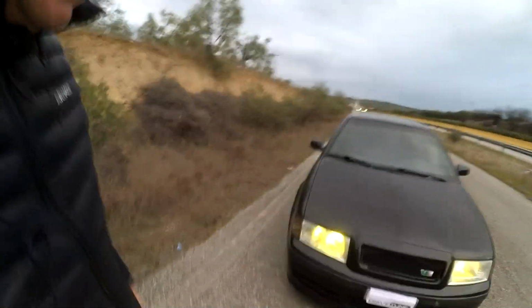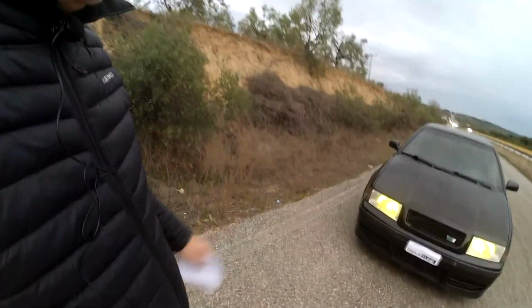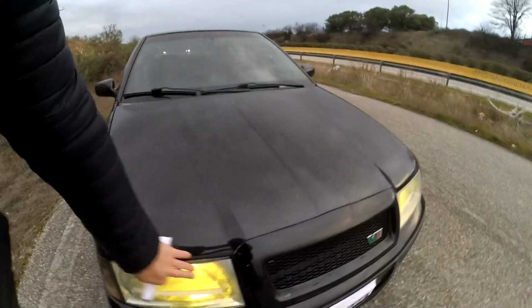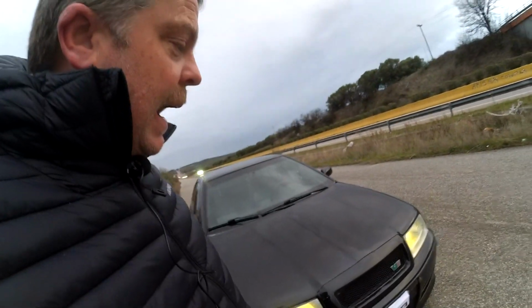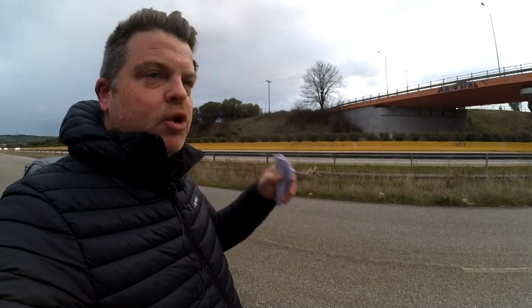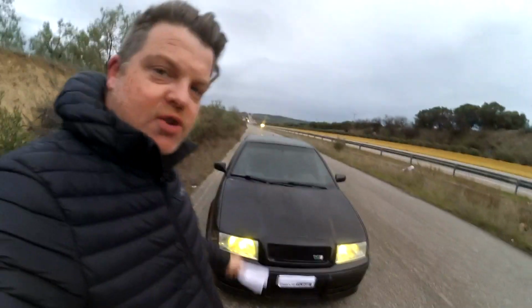And I think the reality is, even this one where I did it lighter, it's still not 100% perfect. So what did I learn from all that? Well, if I was going to do it again, I think I'd go with option one, which was the electric sander. That way I'm going to get a perfectly flat surface, absolutely guaranteed, because the surface at the bottom of the sander is flat. And when I come to do the lighter sanding, with the 600 grit and then the 2000 grit, I think I would have been able to understand if there was still film on the light or not. So that was the mistake I made. The electric sander with a flat surface was the way to go.